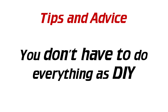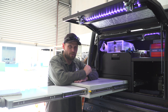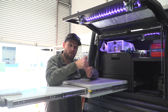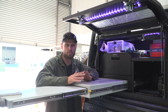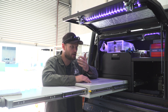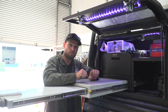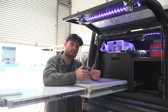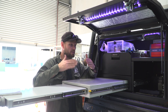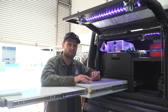Doing most of this work at PDP was beneficial — I could ask for advice and they'd prevent me from taking shortcuts. For soldering and crimping terminals on thick wires, you need a proper crimping tool. Most people won't have that at home. What I suggest is taking your terminal wires to a shop and getting them to crimp the lugs on the ends. Get the measurements right and have all the wires and terminals ready — everything else is quite straightforward once you get into it.